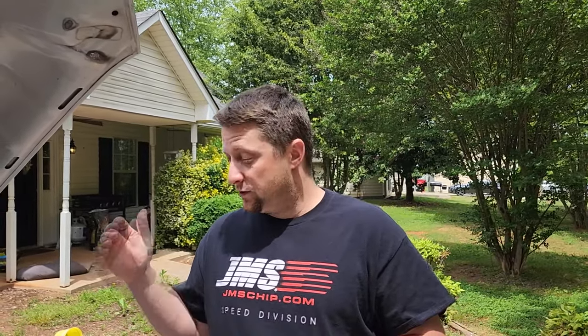What's up Mopar fam, hope everybody's having a blessed day. Today we're working on Frostbite, finally looking into the issue I've had for the last couple of years. I've honestly just been lazy and haven't tried to figure out this problem, but for the longest time I've had a battery drain issue on Frostbite, which is my 2011 Ram RT. I've had to keep it on a trickle charger, especially because I don't drive it that much anymore. If I don't keep it plugged up, it will not start — it doesn't matter how many batteries I buy, they're always dead after about three or four days. So today we're finally gonna tackle this and try to figure out what is draining my battery.